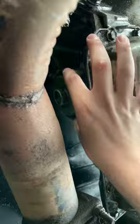I put it back together and put back in my C ring. My original problem was when I would shift into either third gear or overdrive — basically when I'd go above 45 miles per hour on the highway — it would start to just dump fluid onto the exhaust and smoke out everything. It was fine for a while, but as you can see, it's not fine anymore and it started to do it again.